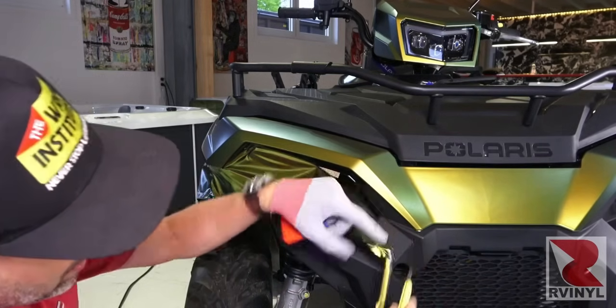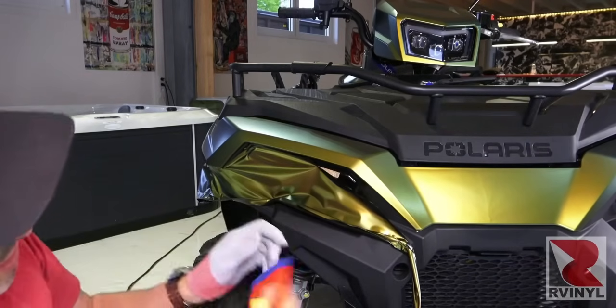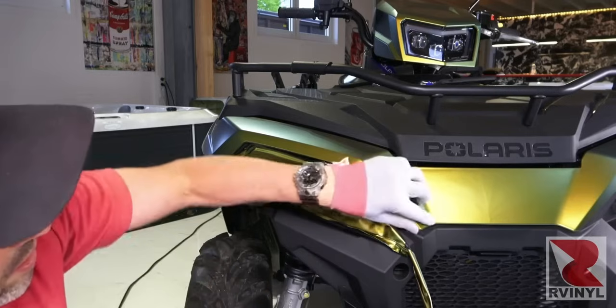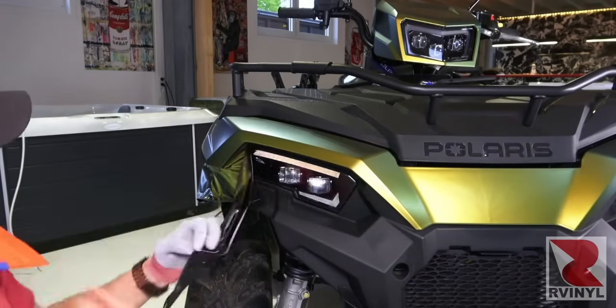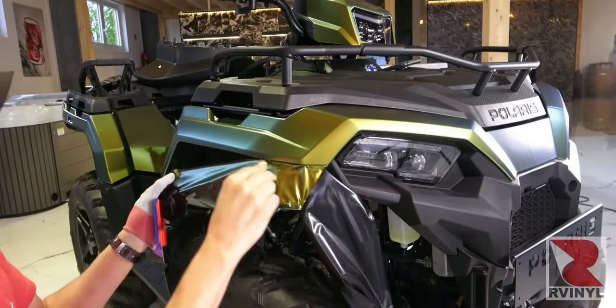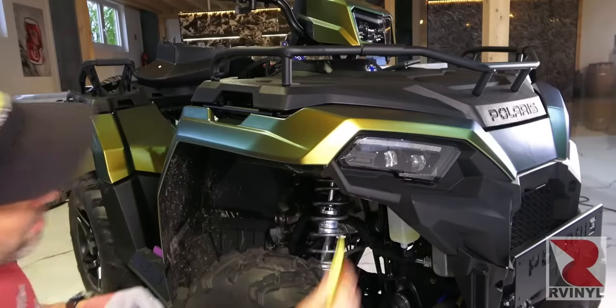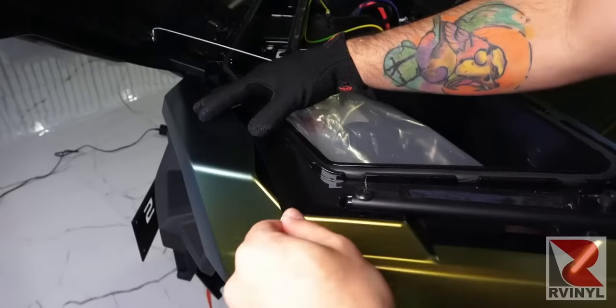and straight. Always use a sharp blade and then come back in with a finger or glove and add heat to bottom sections so the material relaxes underneath the transitions. So here you've got full coverage underneath the bottom section and no tension on the corners and recessed areas, so it's all about technique with ATVs. And notice how the free hand holds the material away while the cut is being made in the opposite direction. This creates a nice, clean, straight cut, and then the application glove seals the deal.